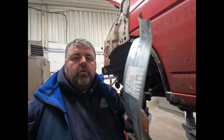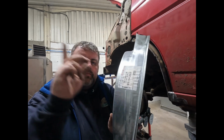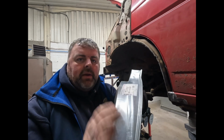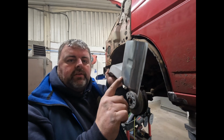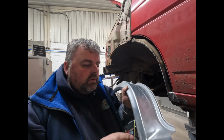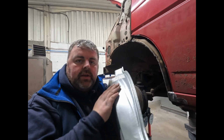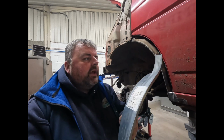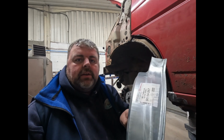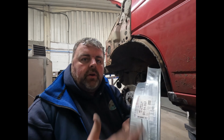Just before I start grinding and stuff like that, I think I showed you on the last video. You'll have to check somewhere on my last video and find that. So basically we ordered full arches which come into the sill. Now on this one I'm going to take it further down because I need a little bit more on this one, but I don't need the whole thing. So to save welding and messing around with the whole thing, if it's not needed then we don't tend to fit it. It's just a lot of unnecessary work that we don't have to do.